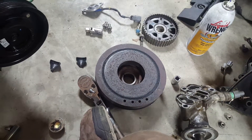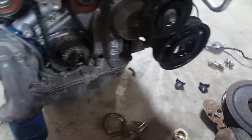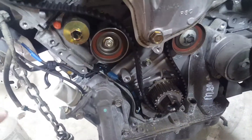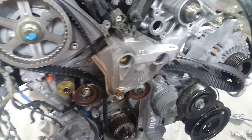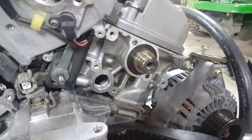That pulley — you can't use the crankshaft pulley remover tool on this one either. Anyway, I got that off, got the timing belt loose, and pulled off the cover, the cam gear, and the cover.